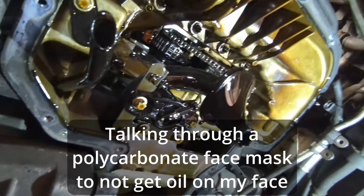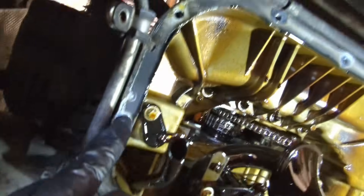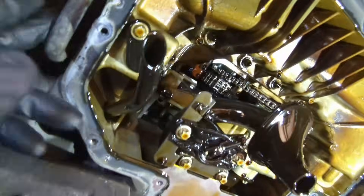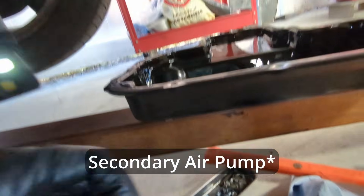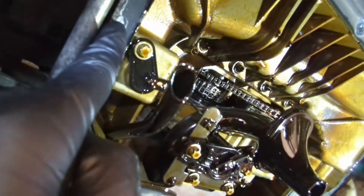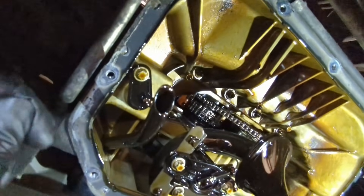Finally got the pan off. It's a little difficult once you remove all the bolts — there's no separate gasket, it's just black RTV all the way around, so it does get stuck. The oil pan has these little standoff provisions. What you can do is get a similar bolt with the same thread pitch — I used the one off of the secondary air compressor because it's slightly longer. It's a torx bit. If you thread it into those standoffs, it'll push against the block and start popping off the oil pan, enough for you to put a screwdriver back there and pry it off.